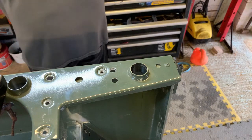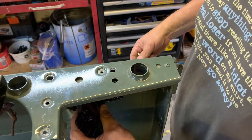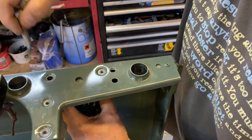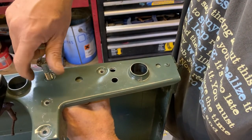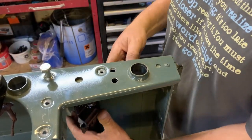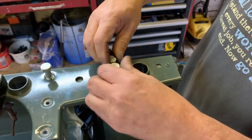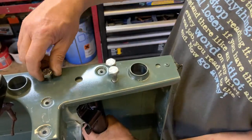Right then, so I've got some bolts here. I haven't got the hardware that comes with the kit out with me, but all I want to do is check for alignment, and then we'll get the other side done. We can see now we can put a bolt in there. It's like it doesn't want to go over far enough. The aluminium's in the way, that's what it is. And I know that I'm right because this is the bolt hole that was already there. So you just push it in, and it's just pushing the aluminium. There's some of the aluminium up behind the capping. So see, these are going in fine. And as you can see, everything's aligned, and we've got movement, so nothing's binding, nothing's tight at all, other than that one because it's up against the aluminium panel.